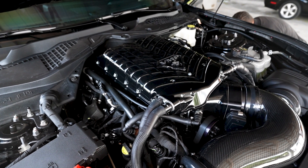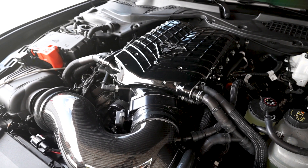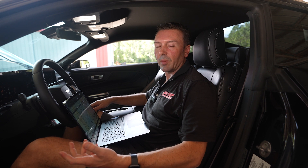So this stage 3 kit is really performing awesome. When you buy this kit from VMP, it's actually going to come with two pulleys — a 3.75 and a 3.625 — so you get some options if you don't want to run boosting or E30 all the time. I do recommend pulling up; don't try to push it without good fuel. It's still very early in modding these cars — this is our first shot with the stage 3 kit, and things could change as more parts and tuning become available. Keep your eye out, make sure you like, subscribe, and share. I'll see you next time.